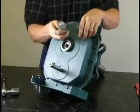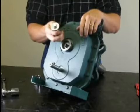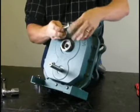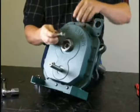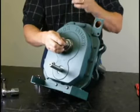One hint: when you purchase the removal bolt, before you attempt the removal process, spin the keeper plate on there to make sure that there are no burrs on the removal bolt. If there are, it's going to get stuck when it's inside and it's going to be difficult — you're going to have to take it apart.